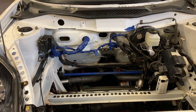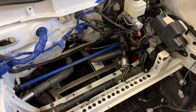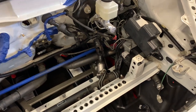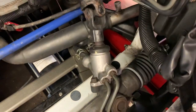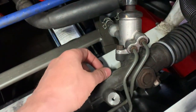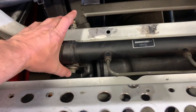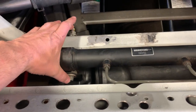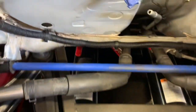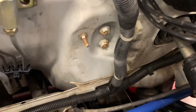If you look around the chassis there's some really interesting stuff that needs replacing - bolts and nuts everywhere. The initial order was more expensive than I like to admit and it got me maybe a fifth of the way there, probably less, because suspension bolts in titanium are expensive. There are little bolts that mount the rack and pinion - M8 by 1.25 - I'll probably do those in titanium too. Some of the expensive ones are these steering rack bolts, like M12, pretty long. And these nuts that hold on the gas pedal - yeah, they look like crap.